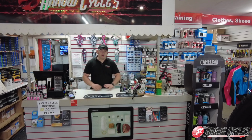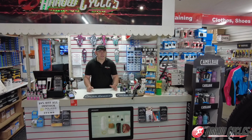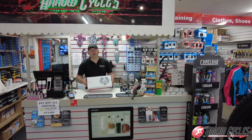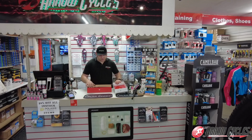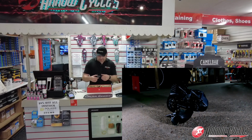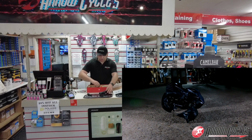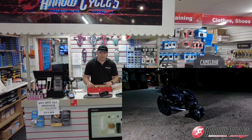Now, originally, when we first started to plan this build, we was going to build the bike with some XT 12 speed, and I've changed my mind on this at the last minute. So now we're going to go with an Eagle GX AXS kit. This is a wireless transmission gear shift, so it's electronic gear shifting. This kit comes with the rear derailleur, the shifter, and the battery charger, so we can mount this to the bike and achieve wireless shifting.